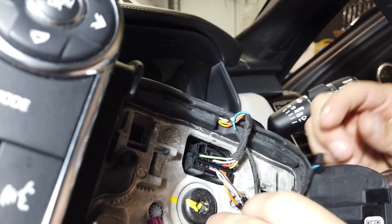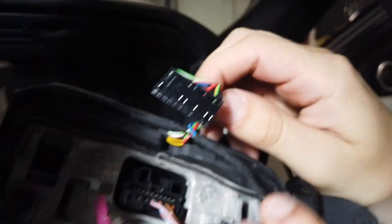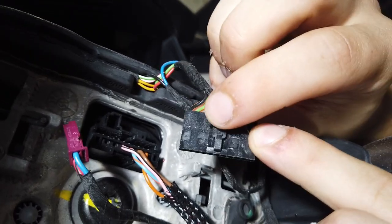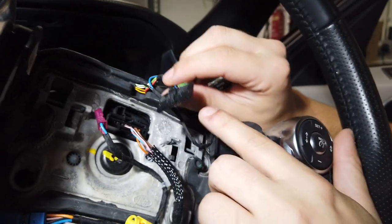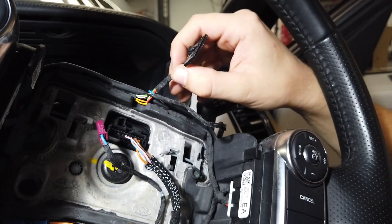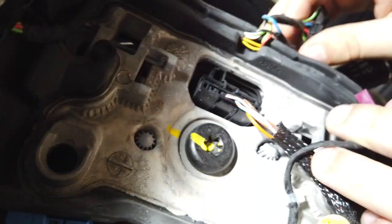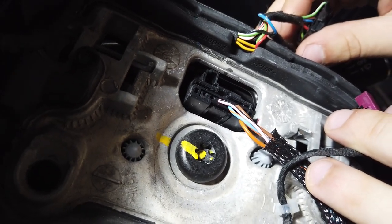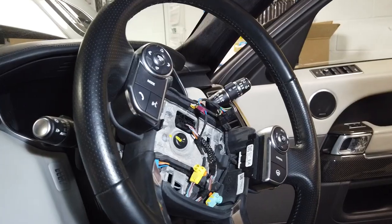The next thin one — there's a little tab on the top. Can you see the little tab at the top Dan? Pull that out. Press that little bit at the top and that releases it — that one comes up. Now those wires will free back through. There's a big Torx fitting in the middle there — I think it's a Torx T50. We'll get that and undo the nut.